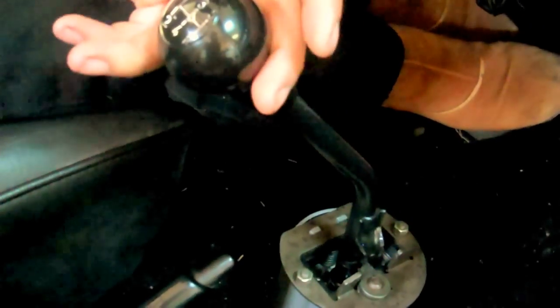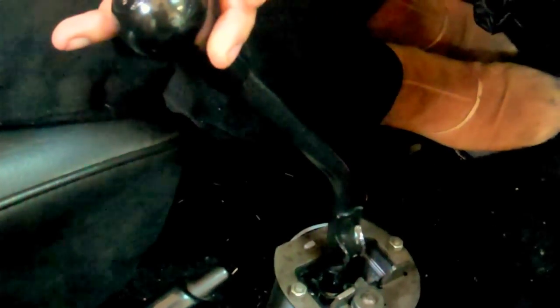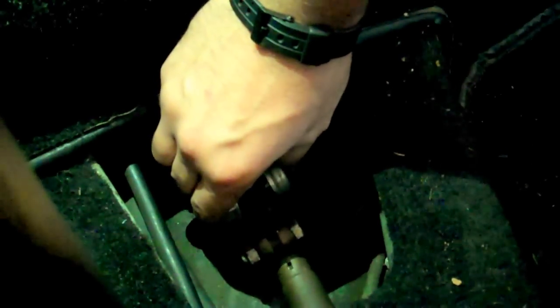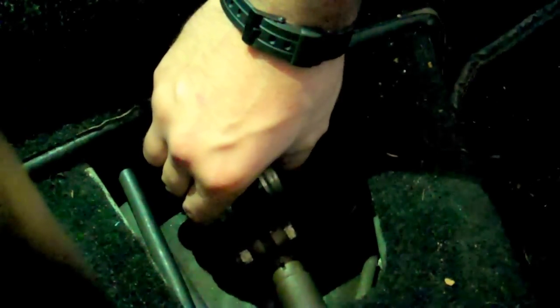Looking back up here, you're going to take this shifter and move it to the far left side, and just put it very gently on there — you don't want to have it too far over. For this particular car it kind of pays to move it forward a good amount until you feel it kind of stop. In doing so you do move this coupler a little bit, so then you have to make sure it's in the correct place. So now that it's in the correct place, you just move it a teeny bit off. I'm making sure this is forward, and when I'm moving this I'm holding this to make sure I'm not messing up my adjustment. They really are very small margins that make a big difference.